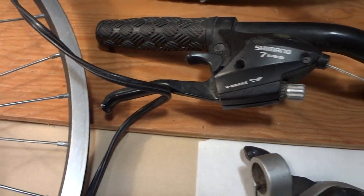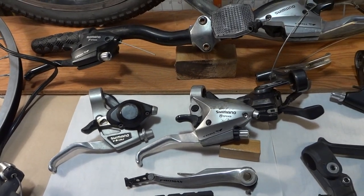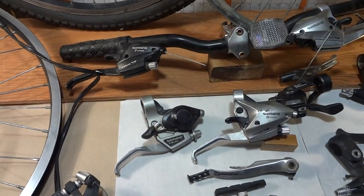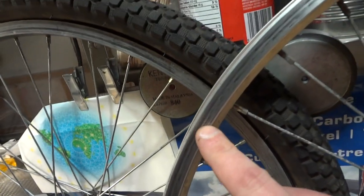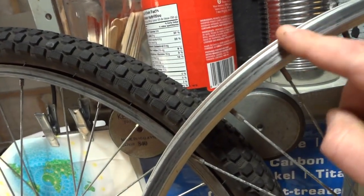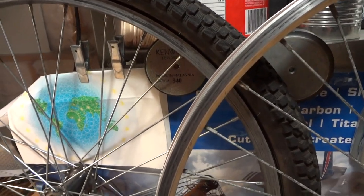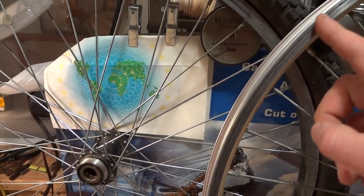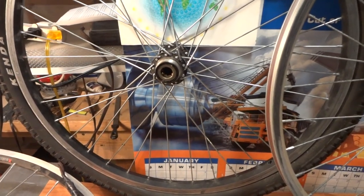The Shimano alloy v-brake is very good — when you press the brakes it's going to be very firm and you'll have very good braking. If you don't have good braking with v-brakes, it's because your rim is too smooth. Some rims now actually have a texture on them, which gives a better grip. Old pads especially on the back wheel tend to slide and not really grip — and the disc brake doesn't work any better when pads are slipping.